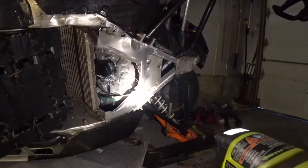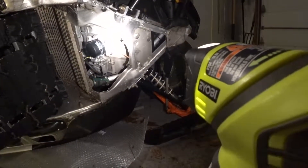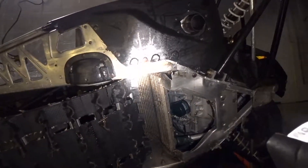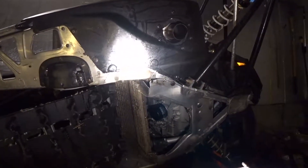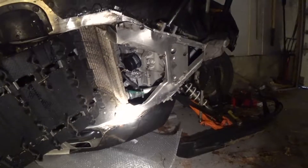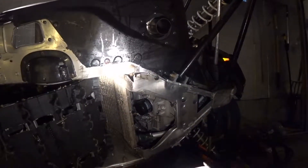I'll drill out those rivets and a couple from the body panel to have a little more flexibility. There's some damage and buckling visible on the side panels, so I may end up taking this side body panel off. I'm still a little undecided — I'll figure it out as I progress — but this one may have to come off just to take out some of the deformation.